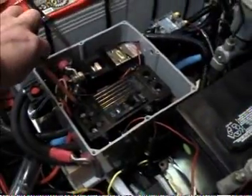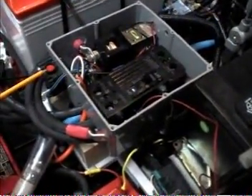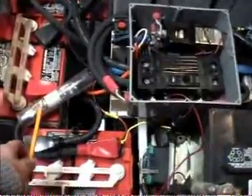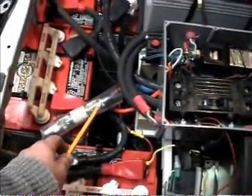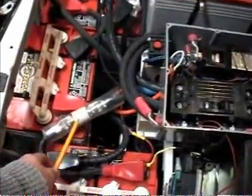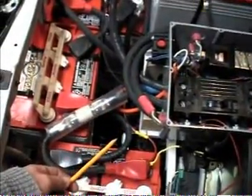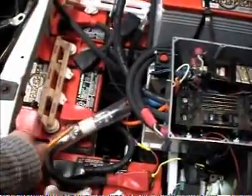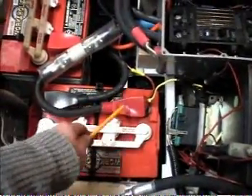So we really just have two extra safety devices here. This relay was only about $16 and it came with the bulk of stuff I bought from KTA. The inertia switch was free — it came with the car and just isn't being used anymore for the fuel pump. When talking about the high voltage system, this right here is a 400-amp slow-burn ceramic fuse. If it detects too much current going through it for too long, this fuse will pop and interrupt the closed circuit. I put it inside a little plastic tubing so that if it does pop, it stays contained. I also put lug covers on all the lugs for extra protection.